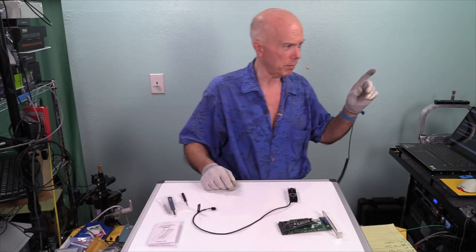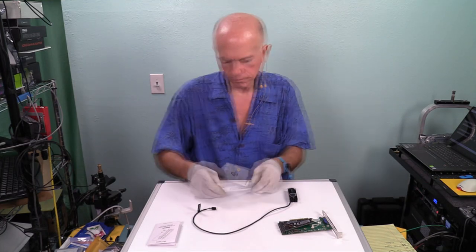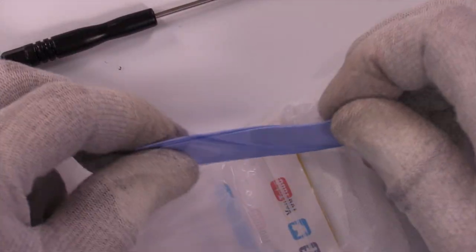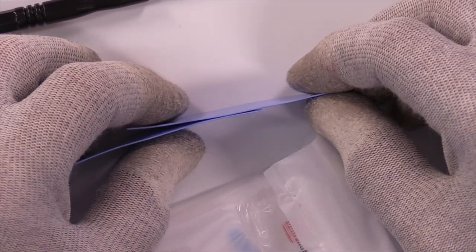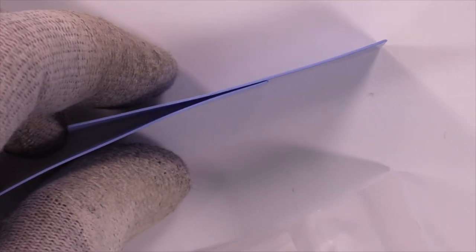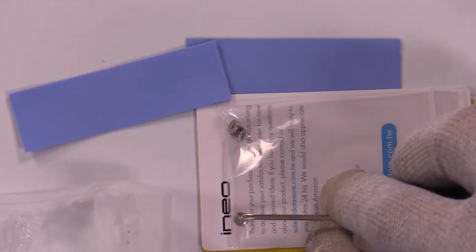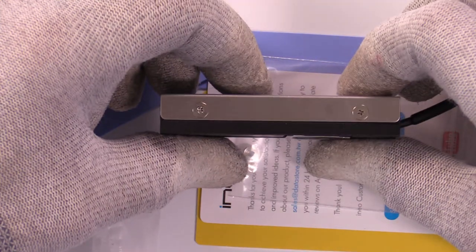What I want to know is the thickness of the thermal pads. The specs say 0.5mm, 1mm, and 0.8mm. The 0.8 will be on top — so the question is whether the bottom pad is 0.5 or 1mm. Opening the bag of accessories: magnetized screwdriver, thermal pads — the documentation says 3 but I see 2 pads here. Both look like the same thickness, maybe half a millimeter. These are solid pads. So to reiterate: screwdriver, 2 pads, 2 screws, and the standoff. We have 2 screws already mounted on each end, we just have to take it apart.